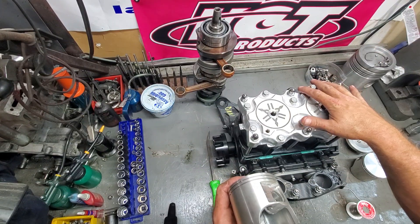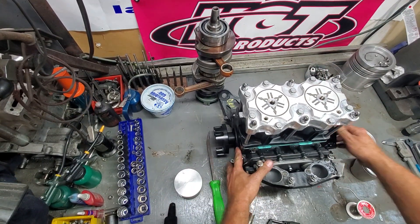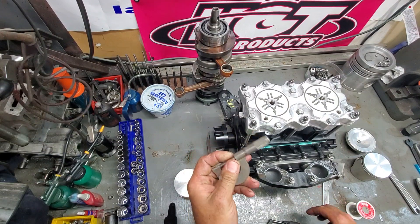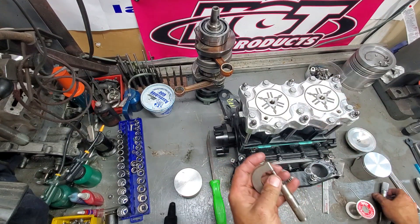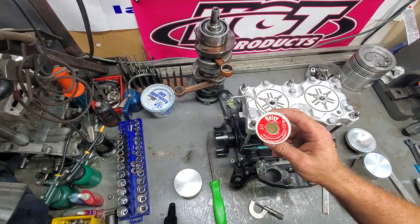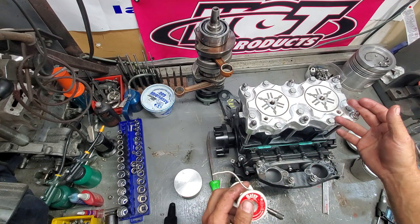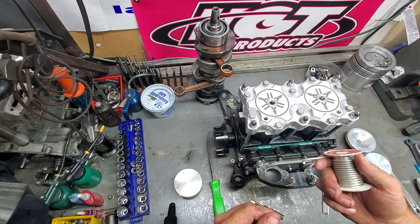A lot of people don't have a clue how to check it and it's really not that difficult. You need a couple tools — you either need a caliper (this is a digital one), or you can use a micrometer, an old style or a nice fancy one. Any of the three works totally fine. The last thing you're going to need is plumbing solder, like you get at any Home Depot, around an eighth inch thick. It has to be thicker than the squish you're in because we're going to put this in the hole, crush it, and then measure the crush.